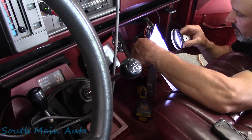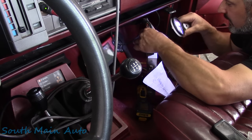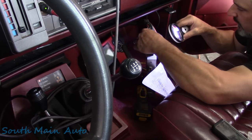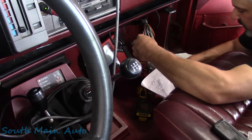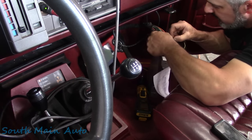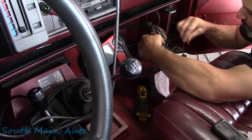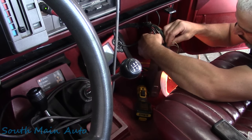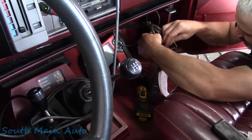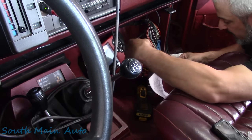And there's another ground, black with white, A12, so that's gonna be this pin right here, this very last one. So we will check that very last ground by going like this, and then we'll probe the known good power that we have. We'll probe it with our high amperage side here. There's that, and a nice bright light there. So that should be all the powers and grounds.